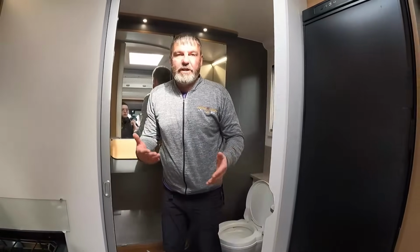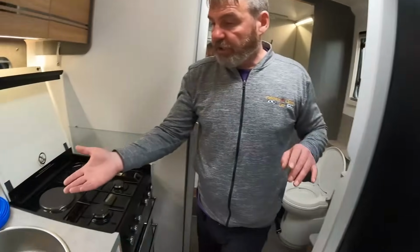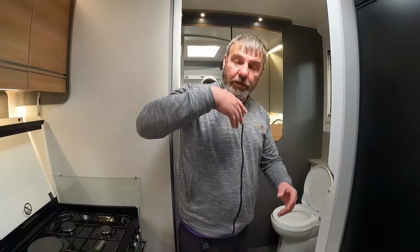And when you're going to use the water, you're probably going to have a wash or a shower, or do a few pots and pans. So there's no great shake just putting the pump on, because if you did have a leak and you had the pump on, the pump will keep going and it'll start to flood wherever it is. Right, there's a good tip for the day.